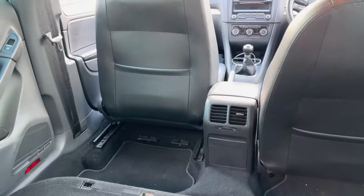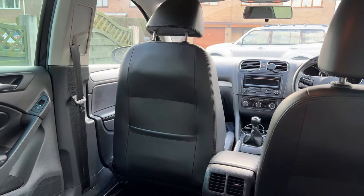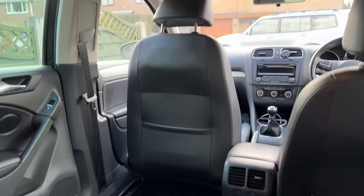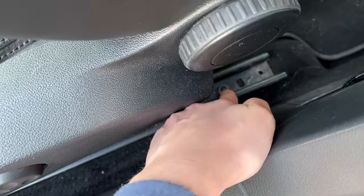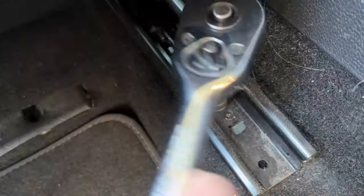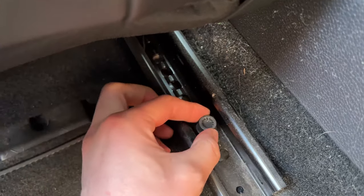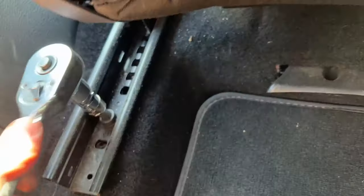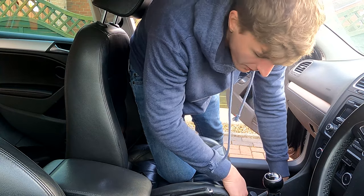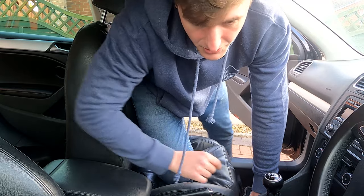Here's what we're left with after the back seats are out. I've actually thought about taking the front passenger seat out too, because the weight of that back seat leads me to believe it's probably at least 25 kilos. I'd love to get 50 kilos out of this if I could — I'll weigh all these parts in a minute. So the front seat is held in by four bolts. I'm just going to take the rail out as well — one there, one at the front, same again on the other side — and this should lift out. It's actually remarkably easy to take all the seats out of your car. The less weight I have to lug down the start line, the better for the drive train and my time. All these bolts are captive, meaning there are no nuts on the underside of the car — they're all captive inside a piece of metal in the chassis, which is useful.